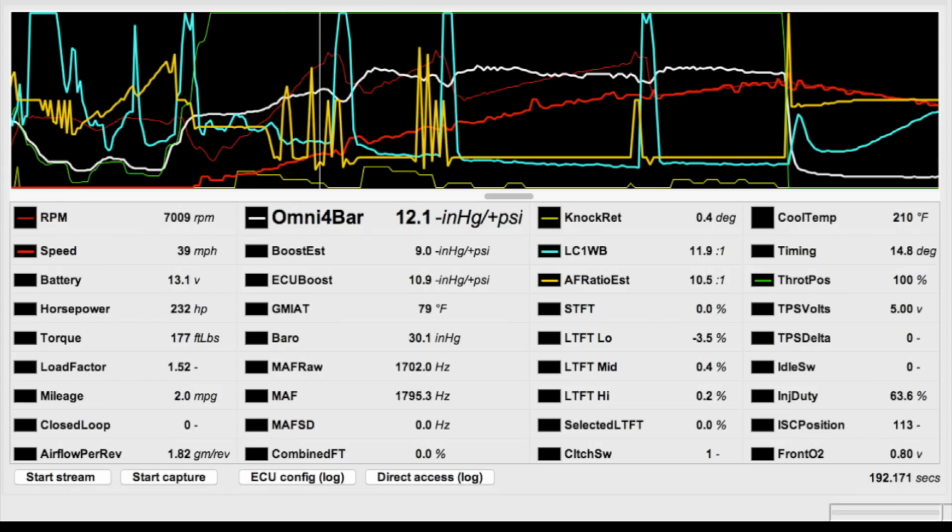And I can play with that more later, but what shows the greatest room for improvement right now is my boost pressure. You see this? It's the white line. I didn't mess with this, and I should have, but you can see how it falls off when I cross 6,000 RPMs. I need to play with my wastegate solenoid duty cycles at 6,000 RPMs and beyond to flatten off a consistent boost pressure, or I'll be chasing my tail around because I'll be bouncing all over the VE table.